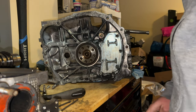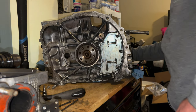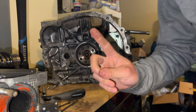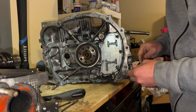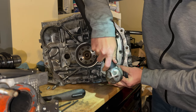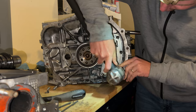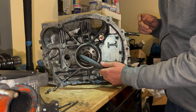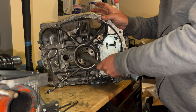In this case, I tried everything from using a bolt extractor to drilling one of them out, and nothing ended up working. I'll link the video above of where I found this technique. But I found that if you take this T-27 bit and a weighted hammer — mine's a four-pound hammer — and you just hammer it in there, it should come straight out. And there it goes. It's worked every single time so far. It's the fourth one I've done now.